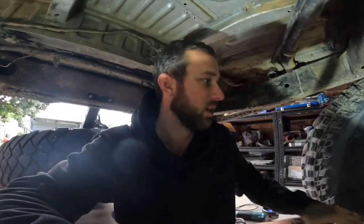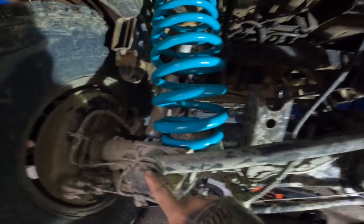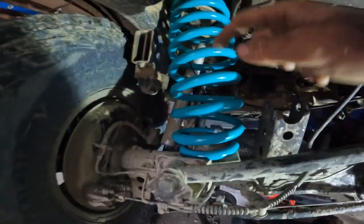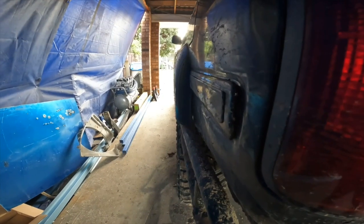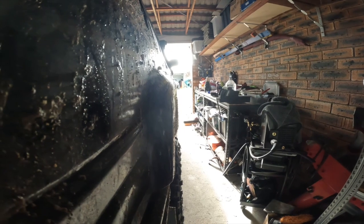Now I'll go spin out my new ones and put them in. I just need to do my re-panhard. Here it bolts to the chassis and then it comes across and bolts to the diff. The more you bring the diff lower from the chassis, what it tends to do is it pulls the car to one side — you can see the tyre sort of sits inside the flare. And that's why you need an adjustable panhard. It's currently pulling my tyres to the driver's side, so we're going to pull them back the other way. Just going to pop that out, put the adjustable one in, make it longer to allow for it, and it'll pull the tyres back in to where they need to be.